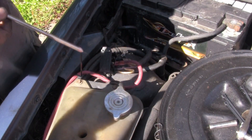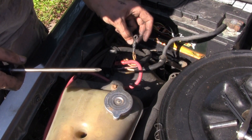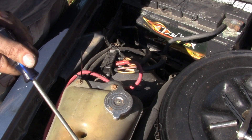That's all there is to the actual upgrade. Obviously there's other stuff — you're going to have to put your turbo tube back on there and tidy up. I'd suggest heat shrinking or taping these, reconnect your battery, tidy up the other stuff. But this is all you need to do to get the new upgraded alternator to charge and work. The AL129X is a little bit bigger, so it's a tight squeeze to fit in from below, but it will fit and all the bolts line up with minor wiring modifications. Now we've got way more charging system capacity that will keep our battery healthy and happy, even in the most severe use in the worst possible climates. Hopefully this has pointed you in a direction — if you need to upgrade your charging system on your OM617-powered vehicle, you know where to go.